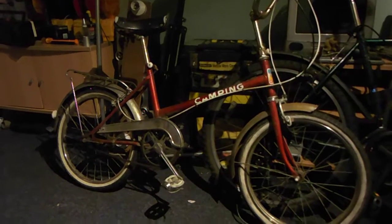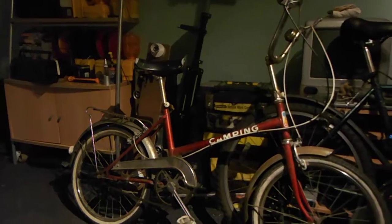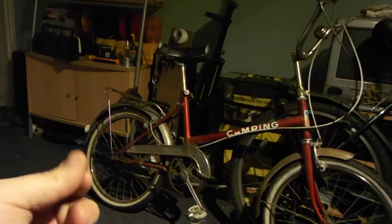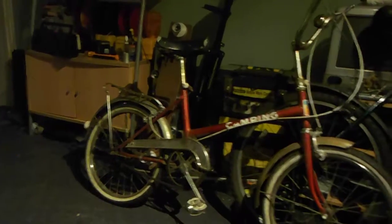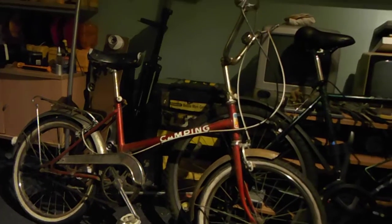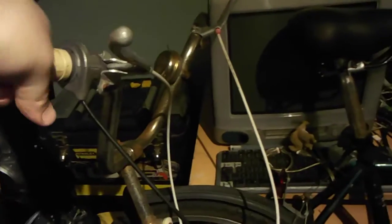There's the little shopper I'm working on at the moment. The original gear lever was knackered, so I had to cut that end off the gear cable because it was a permanently fixed screw thread — I don't actually know what they call it — with a bit that basically connects the gear cable to the toggle chain, just to get the cable off, because the cable was knackered up at the gear lever too. I found this grip-shift style lever which doesn't clamp on the handlebar very well, and it's not actually shifting between three gears. I'm probably just going to stick an ordinary gear lever on it — I'm not sure where I'm going to put it yet, but I think that's what I'm going to do.